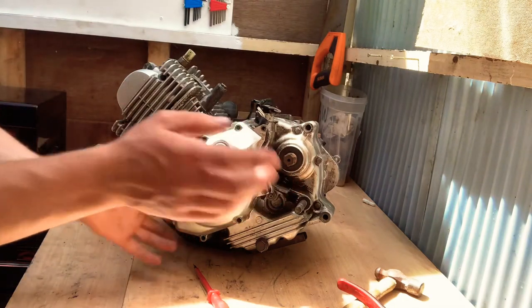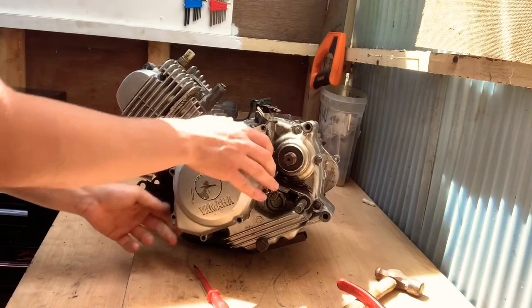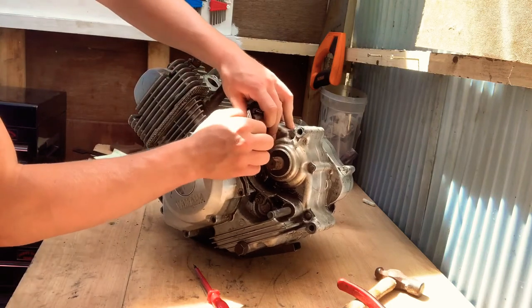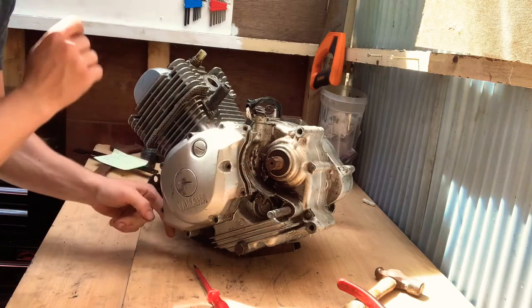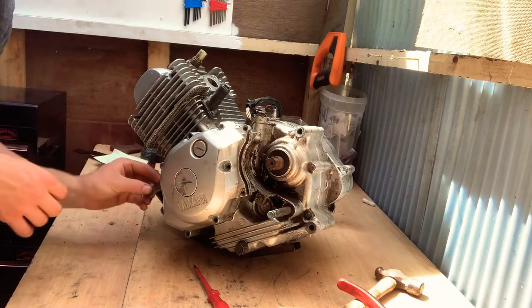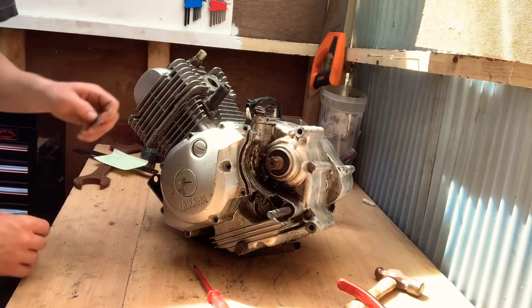If it's a bit stuck, you may want to use a rubber mallet to give it a tap all the way around to loosen it off. Then just grab the little tabs and give it a wiggle. This side is a bit different to the clutch side, because after you wiggle it off you get around to the stator lead. Because of the big magnetic flywheel in here and these stator windings, it actually wants to pull itself together shut all the time — it just wants to slam shut on your hands.